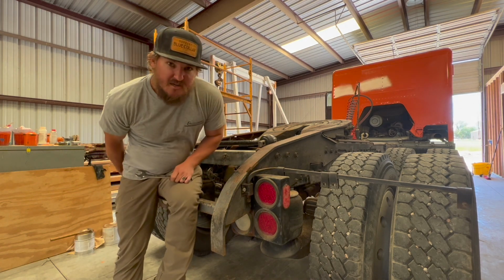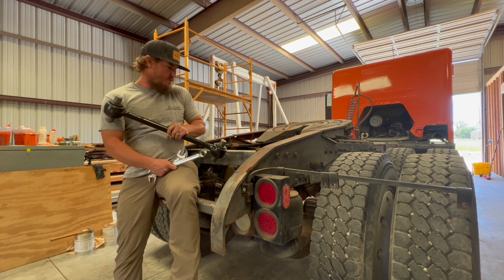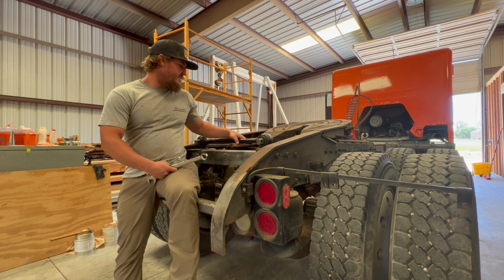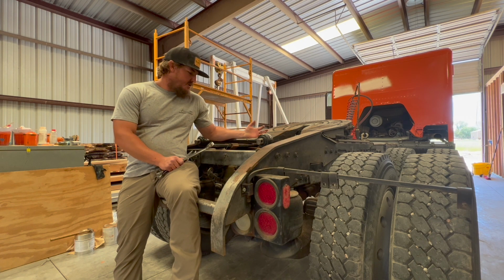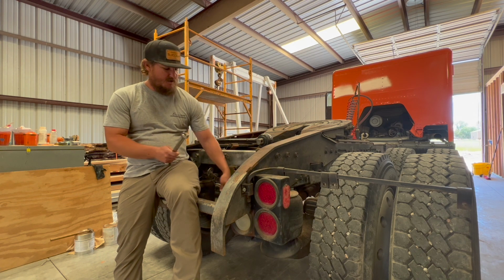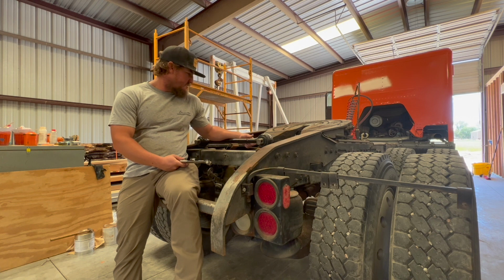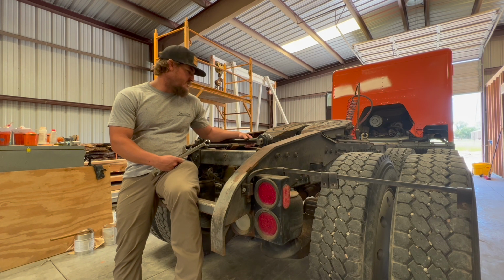Coleman Farm YouTube channel. Today we are going to be changing out one of our torque rods in the back here on the suspension. I found a few other videos of some guys changing them out. Biggest thing was having the airbags fully inflated and then back off your bolts, make sure they're loose, and everything wiggles right now. So we're going to go ahead and dig into this, pull one of these torque rods out